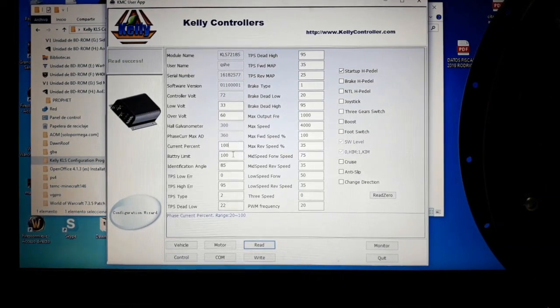The next value is the battery limit, which is the maximum continuous current. You set it according to your setup. The limit will probably be your battery — if the battery can only provide up to 50 amps, reduce this value appropriately. It's also a percentage; this controller can go up to 80 amps, so putting 50% means only 40 amps. It depends on your motor and battery.